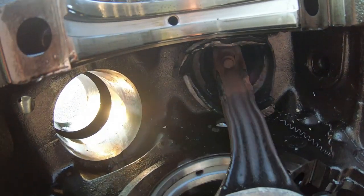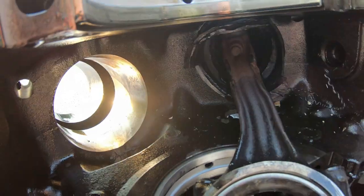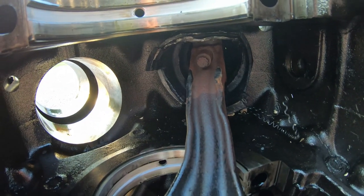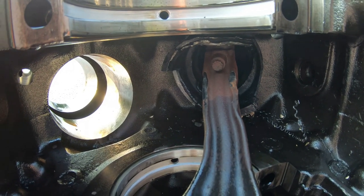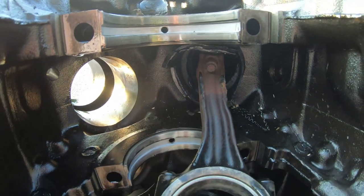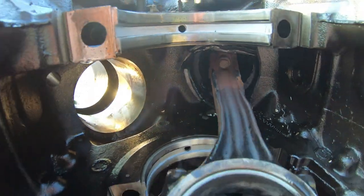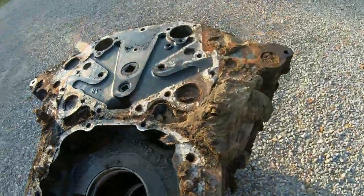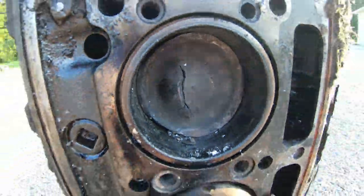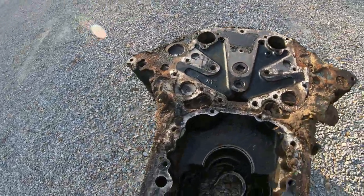And what you're looking at here, hanging out of the bottom, that's the bottom of the piston. The bottom of the liner broke off and fell into the oil pan. Those chunks that I found laying in the valley were chunks of piston, not block. But all that's moving separately from the crown of the piston, that's not moving at all. So that's what failed.